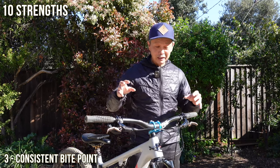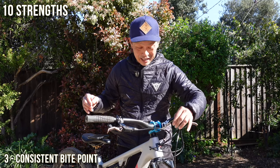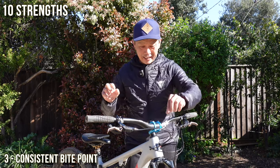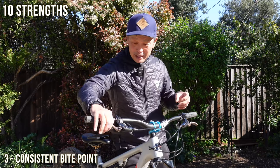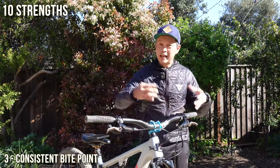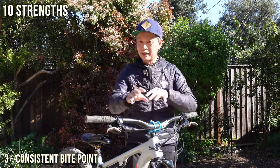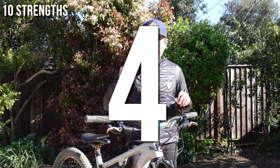Even the Mavens have a wandering bite point right now, and Shimano, as good as they are, has a wandering bite point depending on temperature. These are so consistent. How do they do it? Good porting and good engineering — but also the hose is bigger, about a quarter of a millimeter larger than other hoses, because it's wrapped in Kevlar. At the limit the hose expands from pressure, and this controls that expansion. That's especially important on the rear brake due to hose length, and the Kevlar wrapping essentially nullifies that.